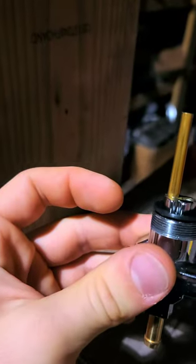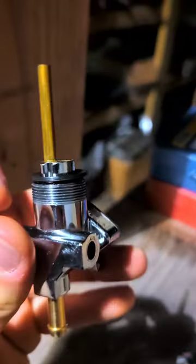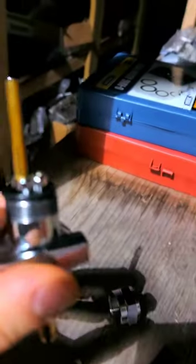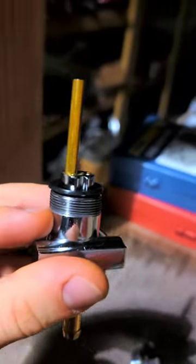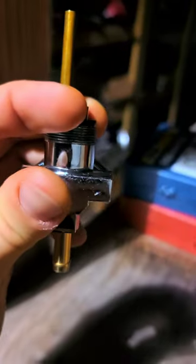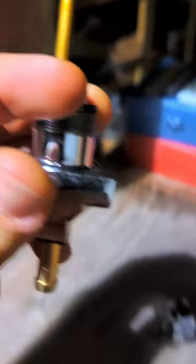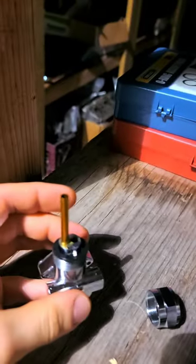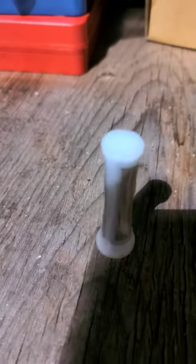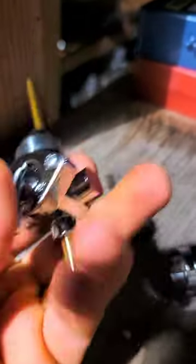Because it's just too large for the setup, this is where we go to the Harbor Freight O-rings and replace it with a proper one. What this O-ring does is it seals the bottom of the petcock to your gas tank. When you tighten the nut down onto the petcock and then tighten the petcock up onto your tank, this O-ring is what's sealing the tank and the petcock together. Since it's not a correct fit and hangs over the side, it gets messed up in the threads and just ends up not sealing correctly. So what I do is actually ditch the screen altogether — I was never able to get it to work with the screen.